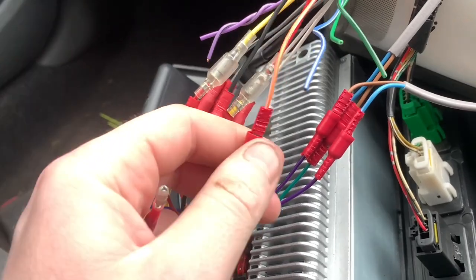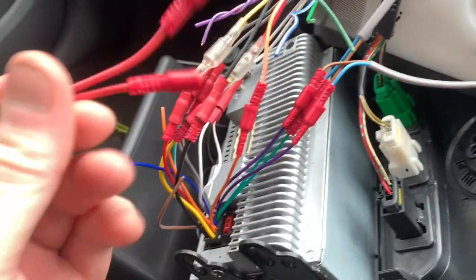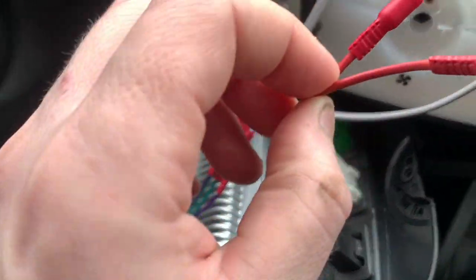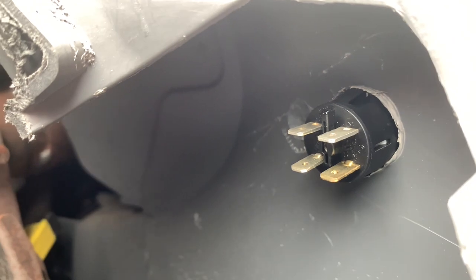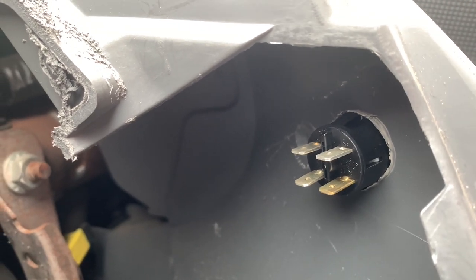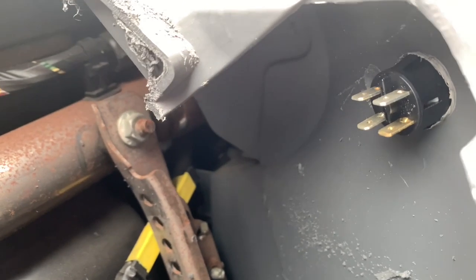I need a feed from when the lights are on — the illuminated radio should do the job. I've made a little wire connector to put into there and then I'll connect that to the back of the switch. The two pins at the top are the ones that make when the switch is pressed in — it's a latching switch not a momentary one. I've got to take a wire to the engine bay then to the back of the relay.